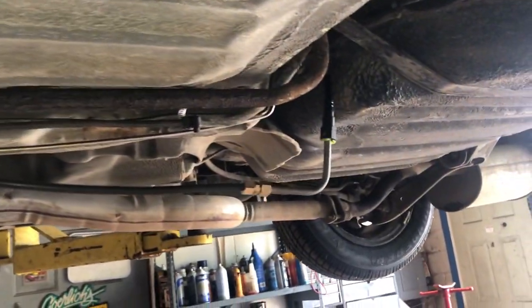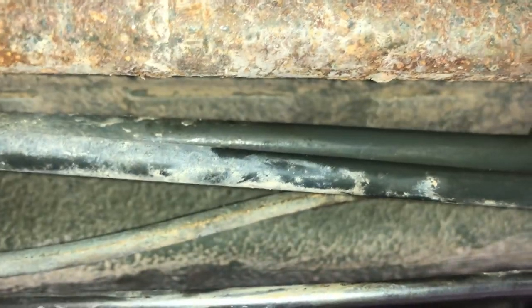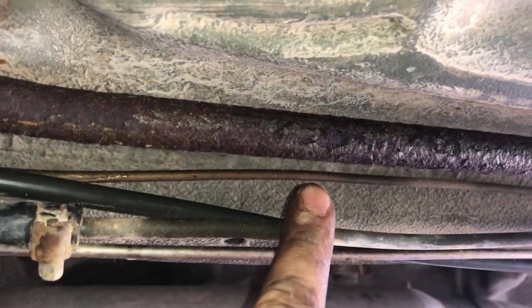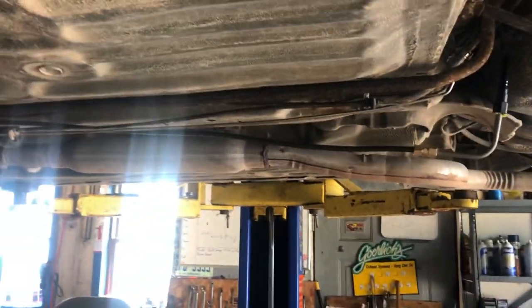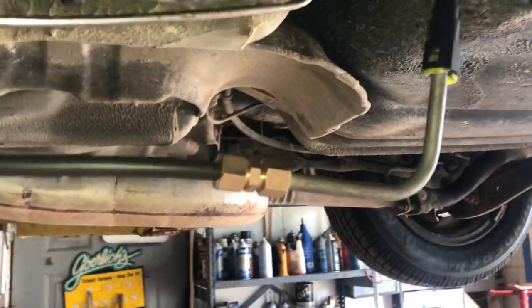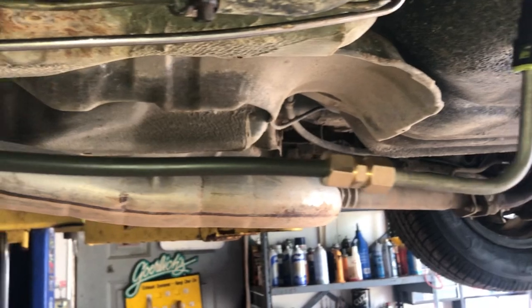I think there were a few hold-downs that whoever worked on this before just took out — if they were still there I'd put it in there pretty. But that's how you fabricate your own fuel lines. If you've got a fuel leak, here's the old line — can't believe it was so rotted. Right up here it's perfect, not a speck of rust, but as soon as you got up to here it was just nasty. You can fab your own fuel line and save a bunch of money. A chunk of fuel line doesn't cost much at all, and compression fittings are like five or six bucks a piece — I buy them by the bag. Easy peasy, guys.